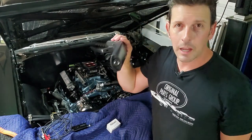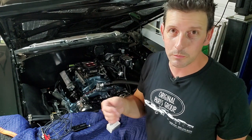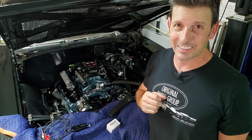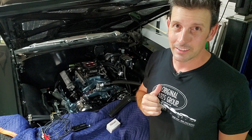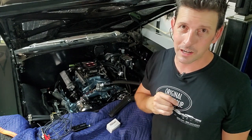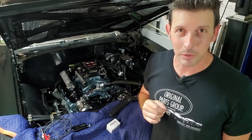It allows a little bit of fluid to go through the engine at all times. I'm a fan of coolant flow, so to speak. Obviously you need a timing light. I already pressurized the fuel system to see if there's any leaks. Nothing else is leaking yet, so let's jump in the cockpit and see if we can get her to crank. Assuming she cranks, I'll warm her up, set the timing, and do a test drive after I do another leak check. Be right back.